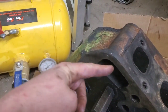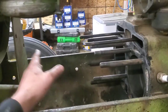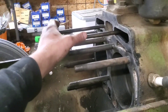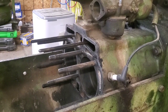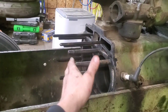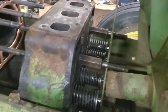The outer push rods have room to go in at an angle, but the inner ones have nothing. You would need to pull them out quite far to clear, and there's no room — the radiator is in the way. Put them in now. I learned that the hard way on this tractor once already; I've had this head off several times trying to fix this issue.